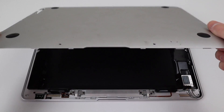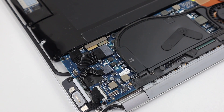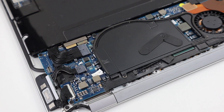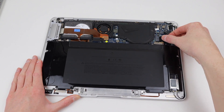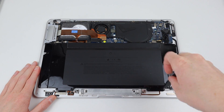To begin, I'm going to remove the bottom panel where we can replace the aging battery, which not only doesn't hold a charge but also isn't detected by the computer. Internally, we can see it's actually quite clean, especially for a laptop of this age. I'll start by disconnecting the old battery and unscrewing the several Phillips head screws holding it into place.